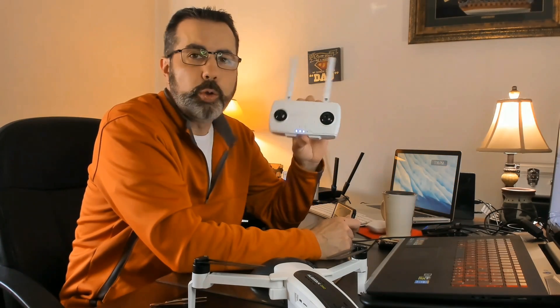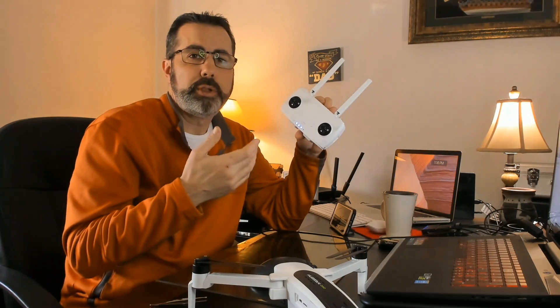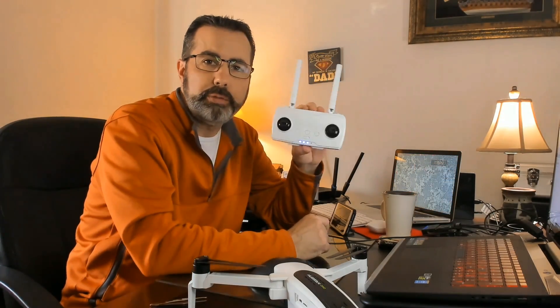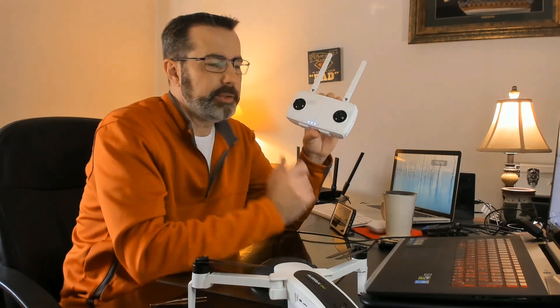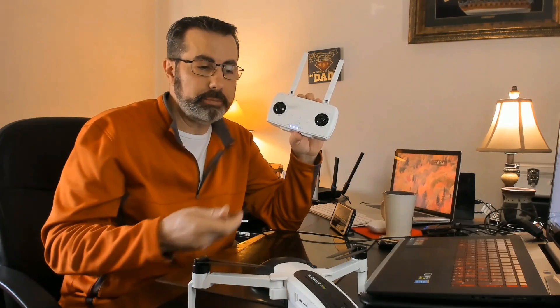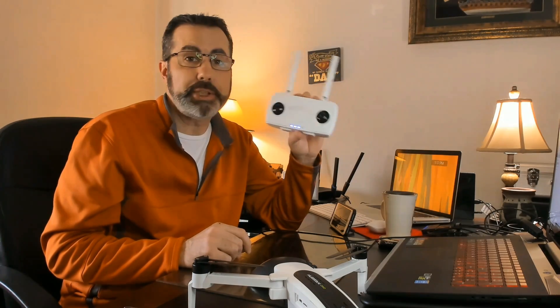This isn't a normal, typical update process — you have to jump those two pins. You can't simply put a micro USB in there and do the update; you have to jump those two pins. It works kind of like a restore and install — it's not just reinstalling firmware over top of another version. It's kind of like a bind plug, where you're simply jumping those two pins. I want to emphasize that you don't constantly squeeze and bend those pins, because each time you do an update they're going to get weaker and weaker and eventually will break.